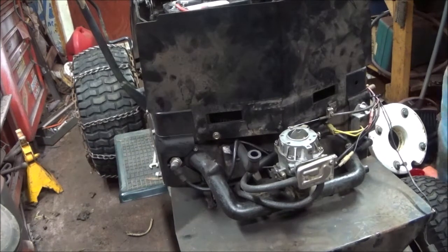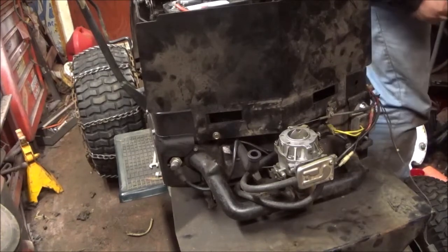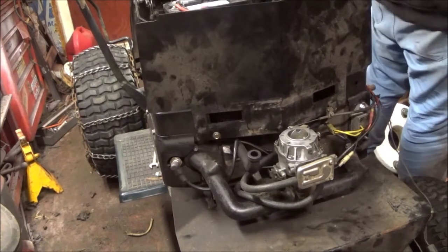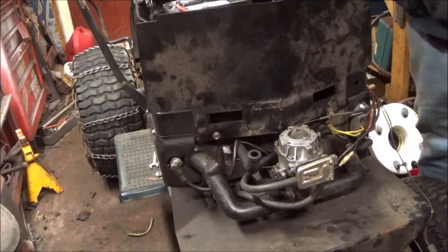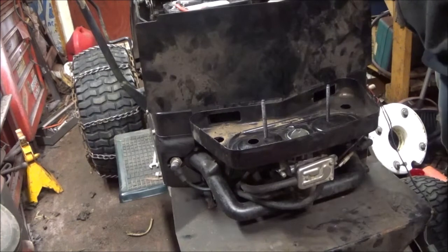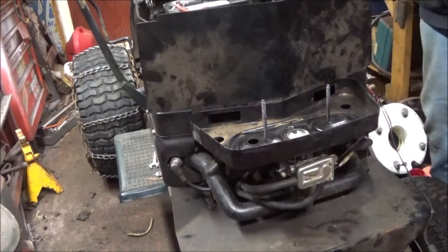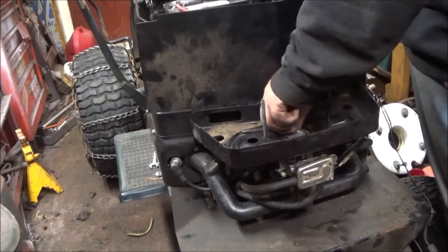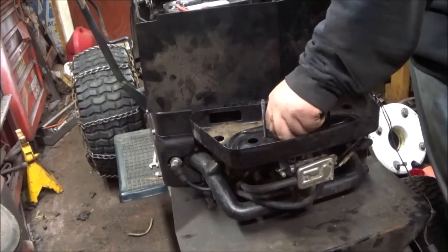Okay, where did I put the air cleaner base? I've been hiding stuff on myself all the time. There's the top. There's the base. And there goes the seat bracket. Close the choke when you're installing these screws. Ask me how I know. When I worked at a lawnmower junkyard, I was working on a customer's tractor and I dropped one down the intake. Had to pull the carburetor off just to get to the dang thing. Oops.